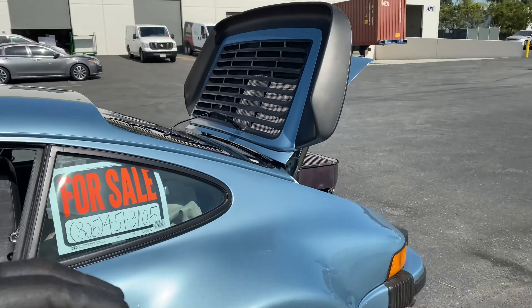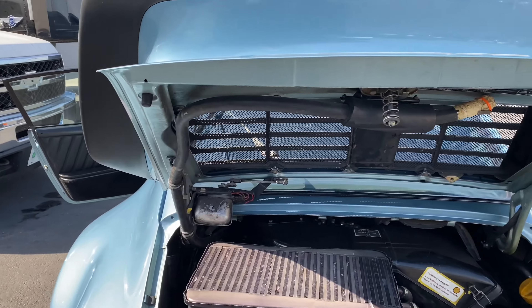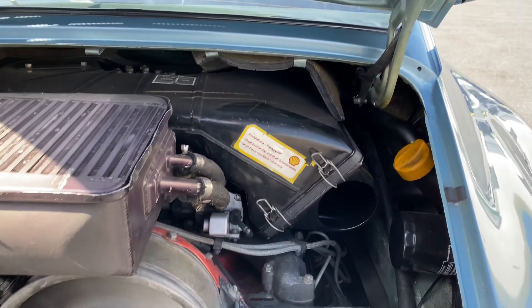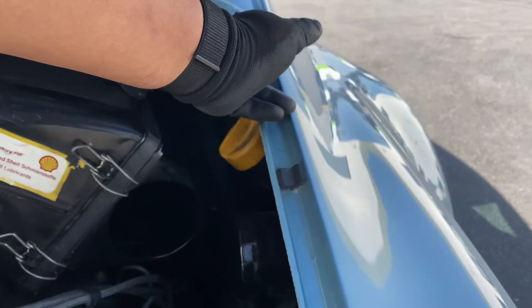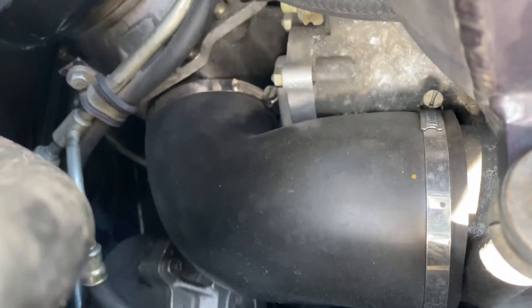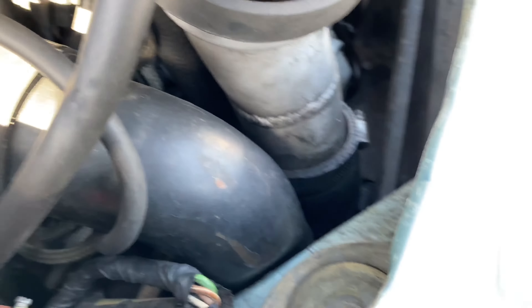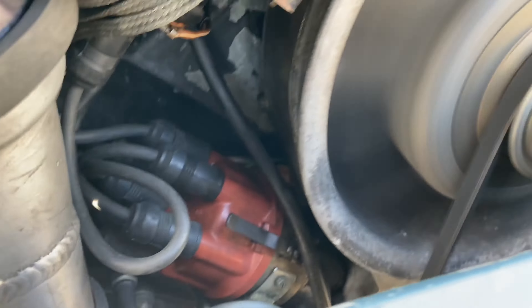Let's take a look at the backside here. The shocks maintain the weight of the panel. You can see where the AC line has been cut — there's no pump there. I'll check the operation of the windshield wiper. I've been looking at all the seams — looks good. Went in there with the LED light just to check the inside, pretty limited as far as what we can see. Didn't see any signs of impact damage. Saw a little wetness there around the distributor cap area — I've got still photos of that. The belt looks good.